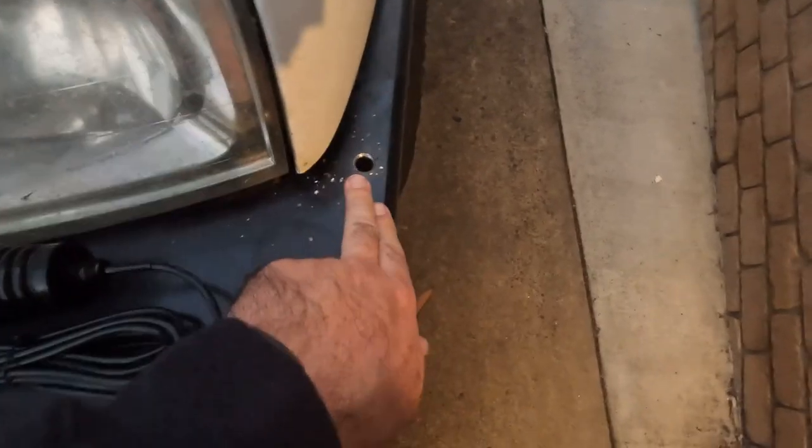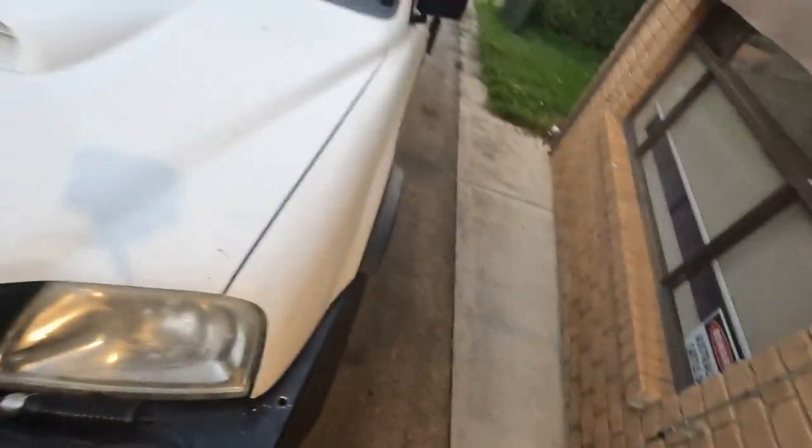We're out here ready to go and we've just come across the hardest part of mounting the UHF aerial — actually choosing where to mount it. For myself I'm lucky because the hole's already there — I've pre-drilled the hole with a 14mm bit. You could probably go a 16mm bit but I found 14mm to be nice and tight so it's not going to move or rattle loose.